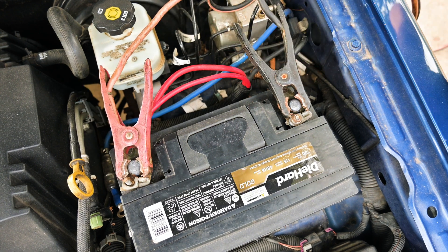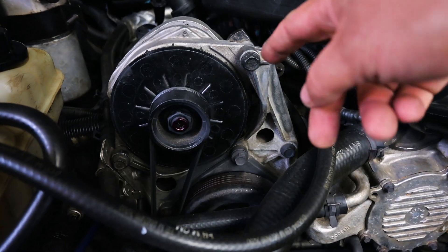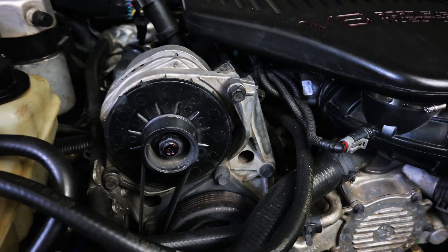If you do have top post, I usually put it straight to the post. But most people like to put it somewhere on a good grounded point, which would be an exposed piece of metal connecting to either the engine or the chassis. When you do this, you don't want to have any lights on in the bad car, or the heat or the blower motor running, because that's just going to draw more current. You will know that you have a good connection when something like your dome light comes back or your dash kind of comes back. You might want to jiggle the handles a little bit to make sure you have a good connection. Let this sit for about five minutes with the good car running and everything off on the dead car — and keep everything off on the good car too. You want as much current going to the dead battery as possible.